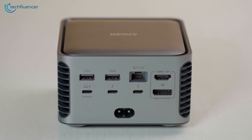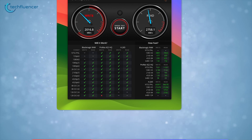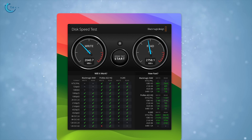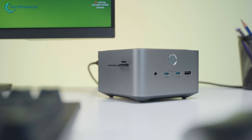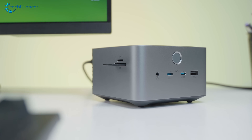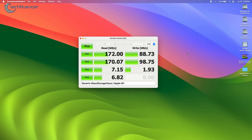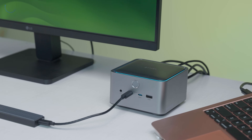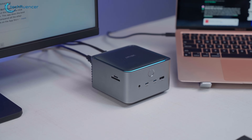Moving to the main attraction — the Thunderbolt 5 ports — we benchmarked using ATTO Disk Benchmark and Blackmagic Disk Speed Test to reflect real-world large-file transfer conditions. Both tests showed strong numbers, up to 2,758 megabytes per second to be exact. However, the SD card reader was less impressive. Despite the premium build, it's equipped with UHS-I, not the faster UHS-II that high-end laptops often include. We tested it using CrystalDiskMark and USB Flash Benchmark, measuring across various file sizes. Sequential speeds topped out around 170 megabytes per second, which falls short for professional-level throughput. Overall, the device's I/O performance is excellent, except for the SD card reader, which could still be a bottleneck for photographers used to faster UHS-II speeds.